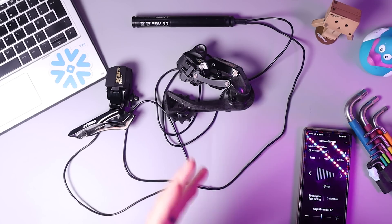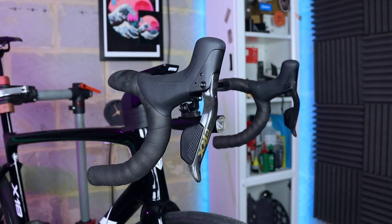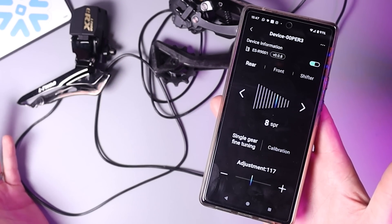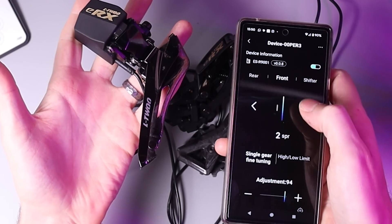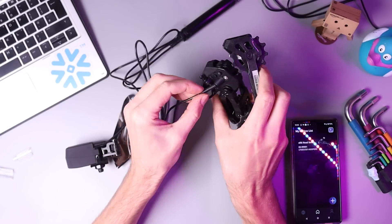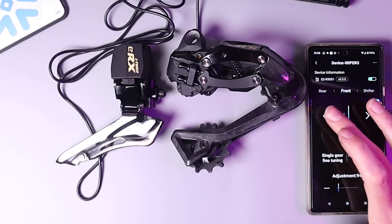So let's begin with the obvious. The bike is in pieces at the minute, so I've removed some stuff to make my life a little bit easier. The shifters are still on the bike but they're wireless like the SRAM E-Tap system — all they do is pass a Bluetooth signal to shift and I can mimic that with the app anyway. So with all the original stuff, I've still got exactly the same issue: the rear derailleur works absolutely fine, no problems. Front derailleur is completely dead, no movement. But I've got some new cables here, so let's swap these in. New cables in — rear derailleur works absolutely fine, front derailleur — no change. Same old story.